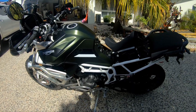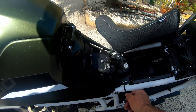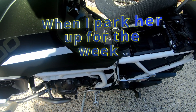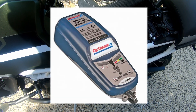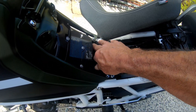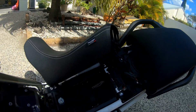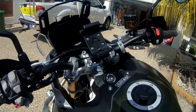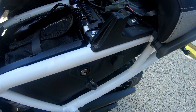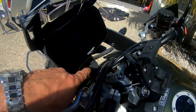Right guys, these are the sort of things I've done to it — she's all clean now. Under the seat, what I've done work-wise is connected a trickle charger. I don't hang it out all the time; only when I'm parked I leave it on trickle charge. When I'm out riding I just tuck it away under here, and happy days, it's all out of the road. Also what I've done is hardwired a Garmin sat nav to this port here, guys. You have to do it to this port — don't do it to the front port, because power is constantly on that.